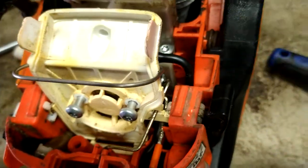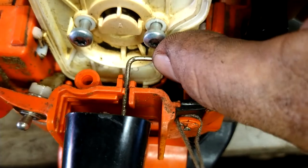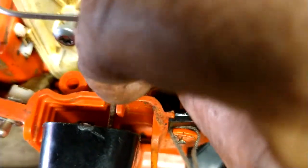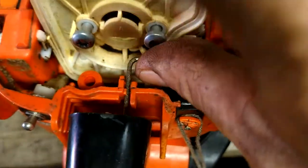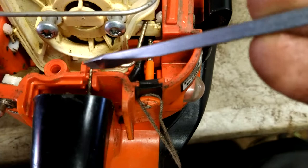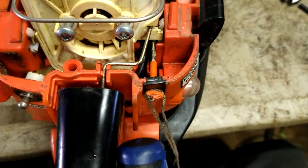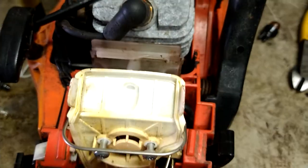That's going to take two hands. Mostly tightened, get it set. It's a little S-shape — you've got to line it up, bring it here, and get a pair of pliers on this part right here and just shove it down into the slot. Push it right down into the slot and then it's there. Now tighten this down, put the third bolt in and tighten it down.